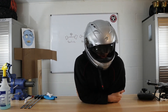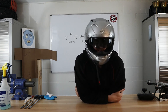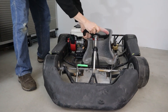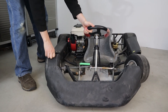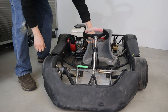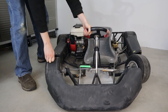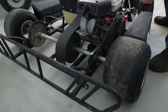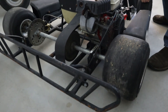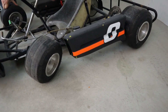Caster on a go-kart actually changes the angle of the tire in relation to the level it sits at. With caster, the inside wheel should actually jack the cart up a little bit. When it jacks the cart up, your go-kart is going to push to the outer angle and that's going to jack up your inside rear tire. That inside rear tire is now no longer fighting with your outside rear tire, allowing you to get a better angle of turn — just as the front wheels can fight each other, the rear wheels can fight each other too.